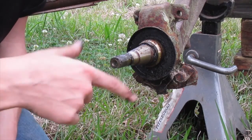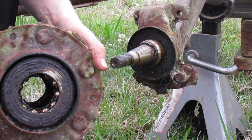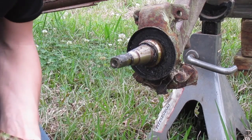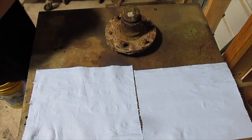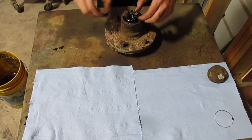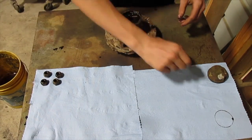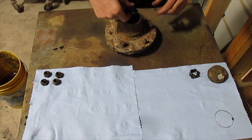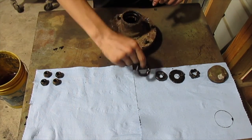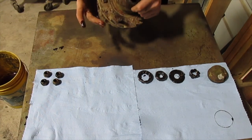When you put it back together you can clean the spindle and pack everything. You can see there's another ball bearing in the back. When you're working on something it's a good idea to have all your parts laid out so you can see everything and know where everything's at — don't have to worry about losing anything. I like to lay stuff out in the order it comes out, just to make sure I don't forget how it goes.